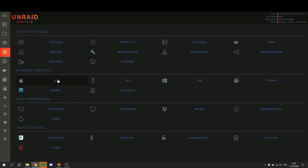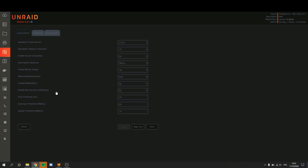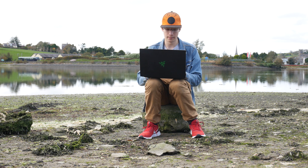Under user preferences we have display settings, in case you have a display connected — mine is running completely headless. Under that we have Sleep Settings, which is another plugin I have installed under user utilities. Sleep Settings allows you to put the NAS into S3 Deep Sleep, basically allowing it to be off or in sleep mode until you ping it on, for example, your SMB port or the port of your Unraid server itself. Wake on LAN is perfect for this — it works really, really well. I used to have that set up before I needed it to run 24/7. Every time I would try to access the SMB share or the web interface, it would wake the NAS up using the Wake on LAN protocol, all set up in my router, made possible by this Sleep Settings plugin. Really cool if you want to save on some power and energy.